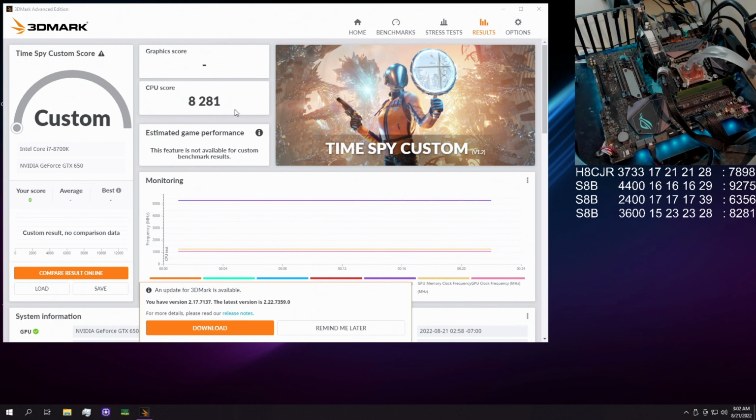But yeah, so these are the final results. If you want just cheap B-die to mess around with, I guess get some of these. They are fun, and they're still B-die, so they still do some things like B-die usually does. It's just that the settings that are important for performance usually suck. It doesn't have much voltage scaling, tRCD sucks, tRRDs and tFAW suck, tRFC sucks, the frequency doesn't go very high. Those are basically the main reasons why OEM B-die is kinda bad.